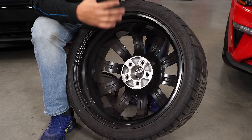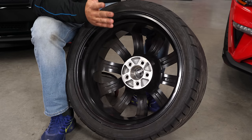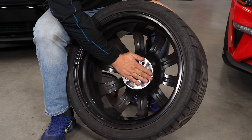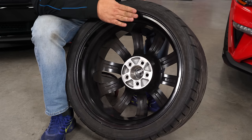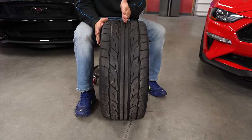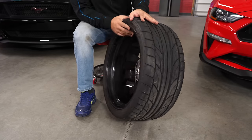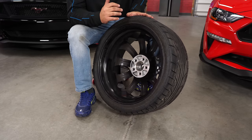When it comes to backspacing and offset we have a great video already on our channel, but let me give you a quick rundown of what it means. Backspacing is going to be the measurement from the back of the hub to the back edge of the wheel. So basically as this number gets larger, this edge of the wheel gets closer and closer to the car. For offset, imagine you draw a line straight through the middle of the wheel — if that line slicing the wheel in half is equal to the hub, that's going to be a zero offset wheel.